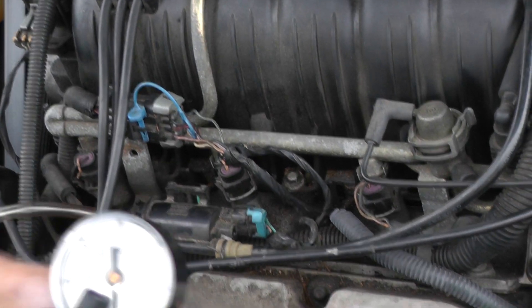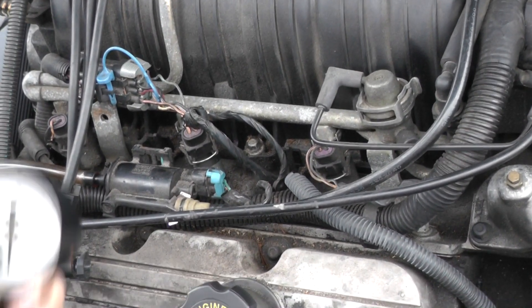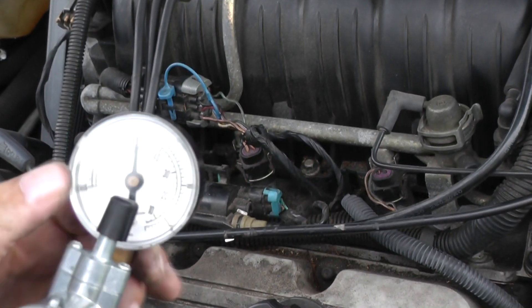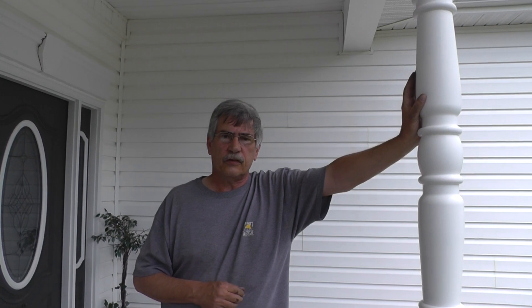So we're going to have to get a new purge valve. Let me see if I can make this thing seat. There we go — now you can see it's working. Right now it's working, but I'm going to go ahead and replace this valve. The valve was stuck open; I tapped it and the valve fixed itself.